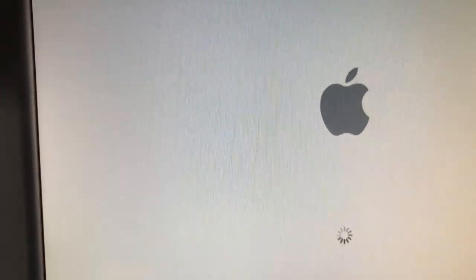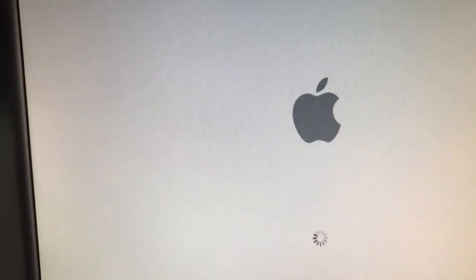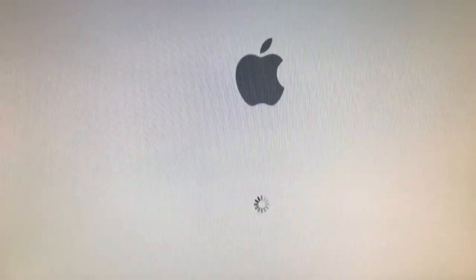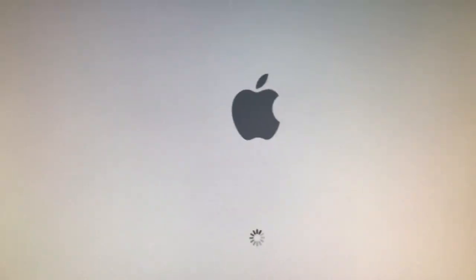And like I said, on the internet it works okay. It's real slow on the internet. It's only 10/100 Ethernet. Like I said, if I had one of those gigabit Ethernet cards, it would definitely help a whole lot on the internet as far as going from one site to another. But I know you're limited with the machine performance on the address bus too, because it's only a 100 megahertz bus.